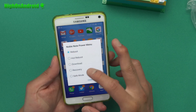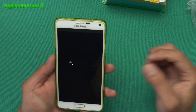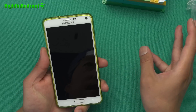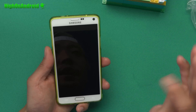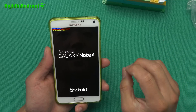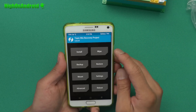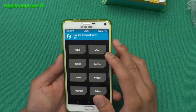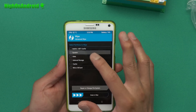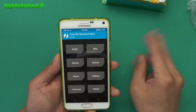Let me show you how to install it. You need to download the ROM file — go ahead and download all the files required for your model and reboot into recovery. For T-Mobile or Canadian you'll need the ROM, a custom kernel, and the voice fix. Use the one on my site because I tried all the others and they don't work. Once in TWRP, go to Wipe, go to Advanced Wipe, format system, and swipe.